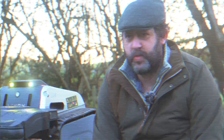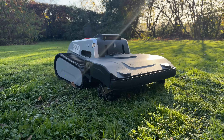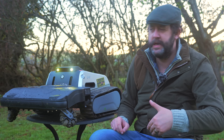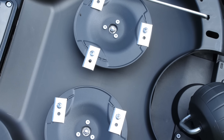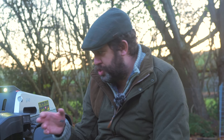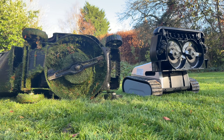Fixed rotary blades - this is Robot Wars! In all seriousness, this was something that intrigued me and it's one of the key differences in the Limo One that sets it apart from everything else. Every other robot lawnmower has had these loose hinged razor blades on a spinning disc style, which you end up having to replace quite a lot because they blunt rather easily. That design was there for good reason - if one of those blades hits something solid, it just gives way by rotating slightly before centrifugal force spins the razors back out to cut the grass.